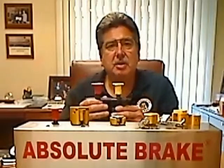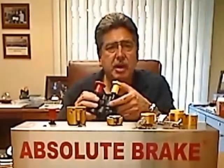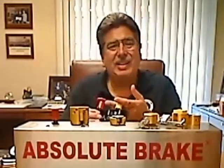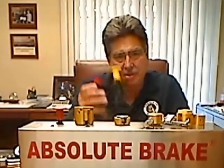Basically, how you use this, if the driver were to get into the cab of the truck, he would push down on this yellow knob, which would release the air into the system, which would allow the calipers to release from the rotor, and now you're freewheeling. Once the driver got to his location, he would then engage the emergency brake, where you're familiar with a big gust of air that comes out of the vehicle. What that does is take all the air out of the system, and the calipers collapse against the rotor, and the vehicle becomes immobilized. So that's a crash course on the push-pull valve.